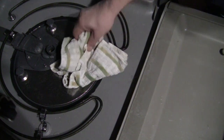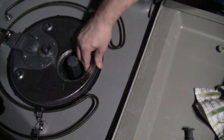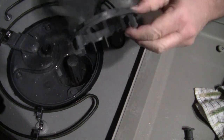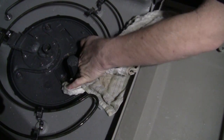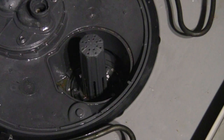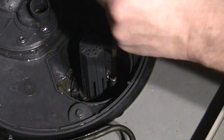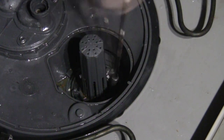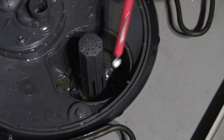As you can see there's water in there, so of course you need to clean that water out. Next take this piece off like so and get it out of the way. Make note of how this piece goes in — the long side goes down. Next, remove the quarter-inch drive screws. Retrieve the screws using either a magnet or needle-nose pliers.